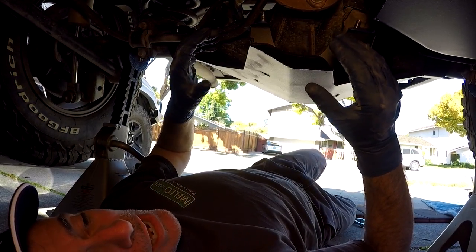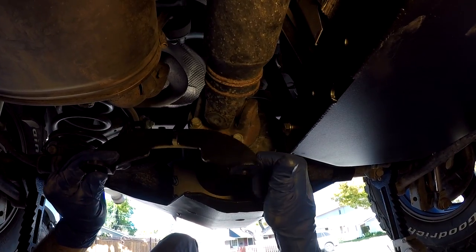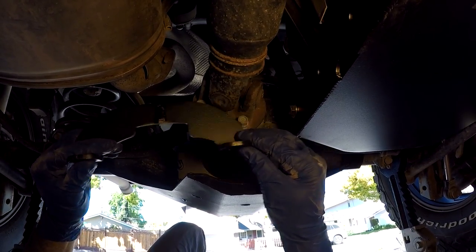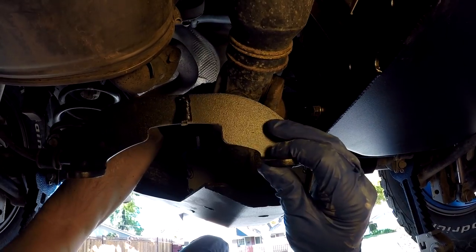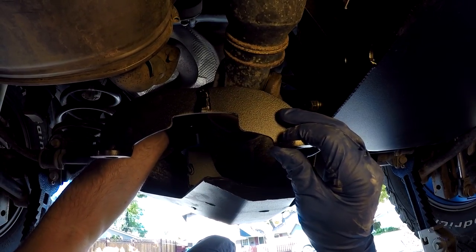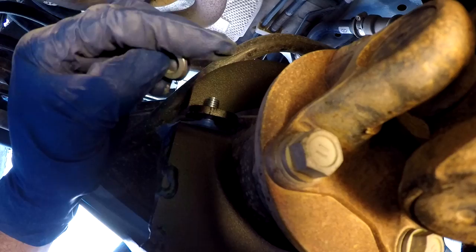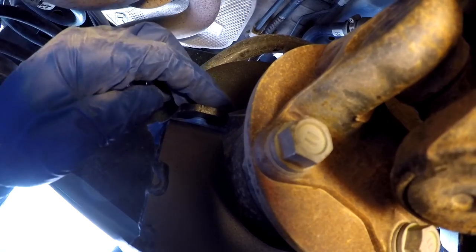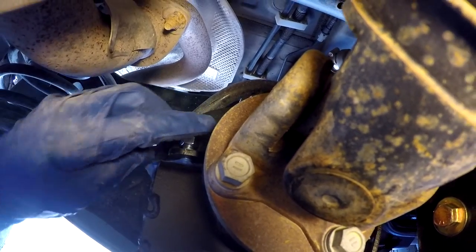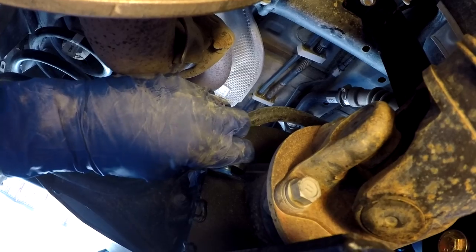Next, we're going to get the pinion flange bracket on — just get everything started and keep it loose so we can still manipulate it. For the pinion bracket, the tabs face the front of the vehicle and the flush side faces the rear. There's a notch cut out so it will fit over the top protrusion on the third member. Fit it over the top, push up on it, get your bolts into the holes, and use a split ring lock washer and then a standard nut — not a flange nut. Get both nuts started equally.